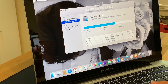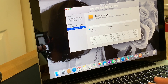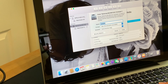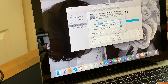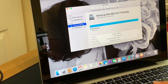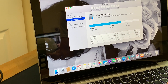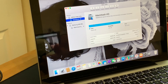As you can see, I've got Disk Utility open. There's the Macintosh HD and there's the Samsung SSD. What you need to do is go to the Samsung — do not go to the external listing, you have to go to the Samsung drive itself and erase it. When you erase it, it's going to ask you for the name, format, and scheme. The format is the important part — you have to make sure it's the same format as your Macintosh HD. If you don't match the format, the process will not work at all. In my case it's Mac OS Extended Journaled Encrypted; yours might just be Journaled if it's not encrypted.